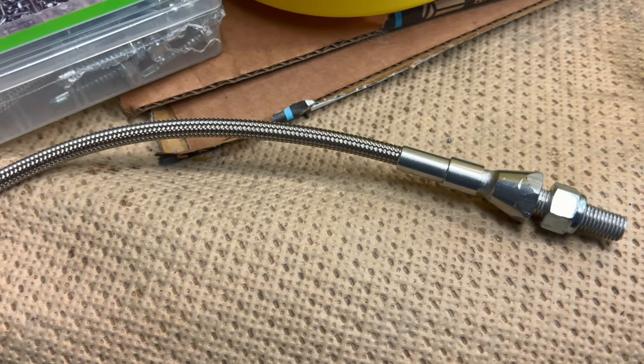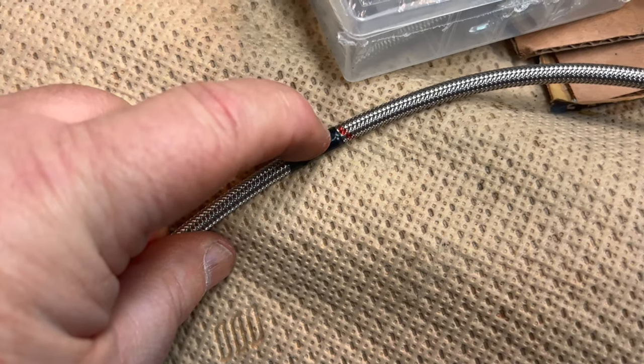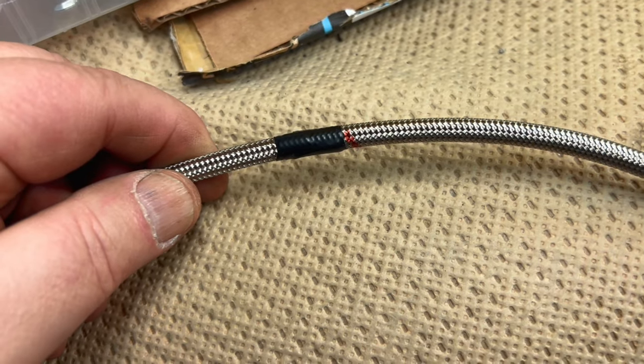And you can see that the ferrule is on this side of the mark. So the intent is to cut it just at the electrical tape. I want to leave a little bit of tape so it doesn't unfurl and end up like the end of this braided cable, because that's the problem. You can't get the ferrule on if you've got those burrs and it's starting to unwind at the end.